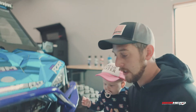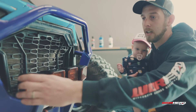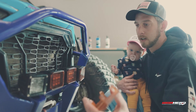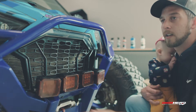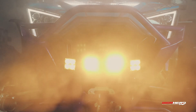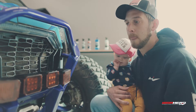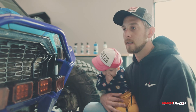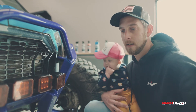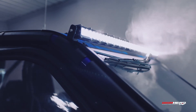I got my Rigid Industries lights here. The two in the middle are driving lights, the two on the outside are actually fog lights, and then I have the removable amber covers. The amber really helps with cutting through the dust — a bright white light will actually reflect back into you and makes it harder to see. I have the two outside ones pointed kind of out, which just widens my overall beam pattern.